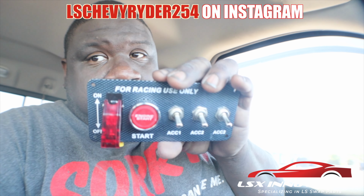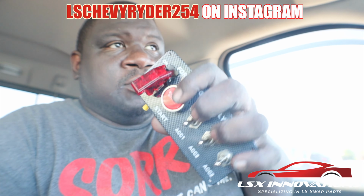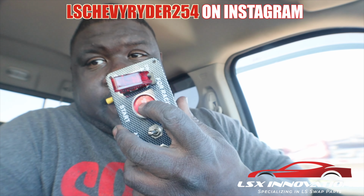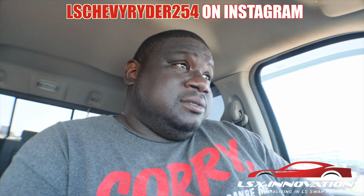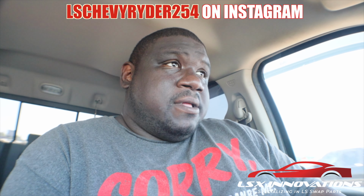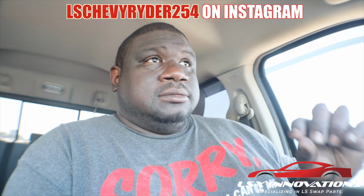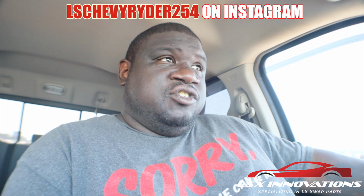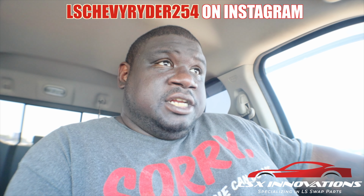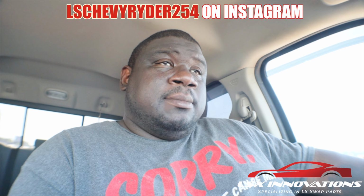But yeah, this is the switch I'm gonna go with. It's safe for racing only. We only really gonna be using this button right here. That way we can start it off. We're gonna wire directly to the starter. But we're gonna keep the ignition in the actual column for now. Maybe down the line we'll swap it out. We'll see.